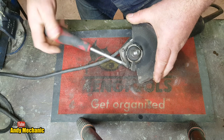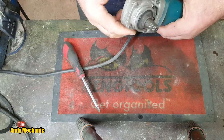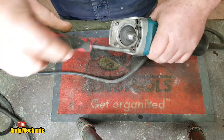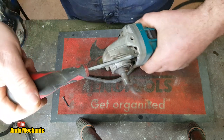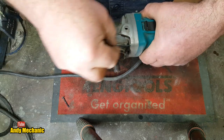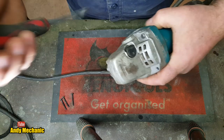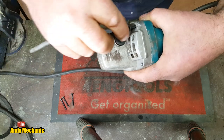I'm slackening that off and it should just come out. There we are. Now I'm not worried about the drive - it wasn't a drive problem, it was a burn smell problem, so I imagine the problem's in the motor itself. We'll whip this end piece off and try to diagnose what the problem was and see if it's fixable. That rechargeable grinder I fixed is still going really well. These grinders are not quite as expensive as the rechargeable ones, so it may not be cost effective, but we need to find out what the fault is first before making a valid decision about whether to repair it or buy a new one. I'm rather disappointed that a Makita grinder failed on us.